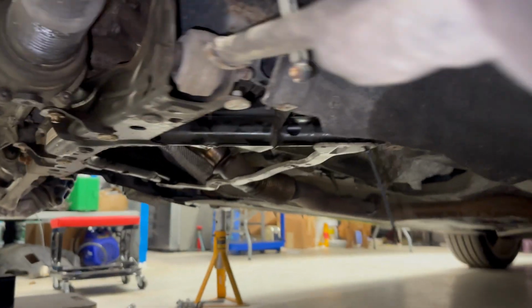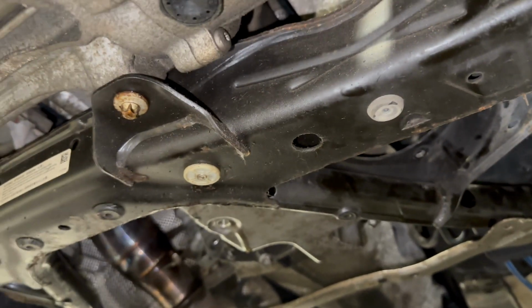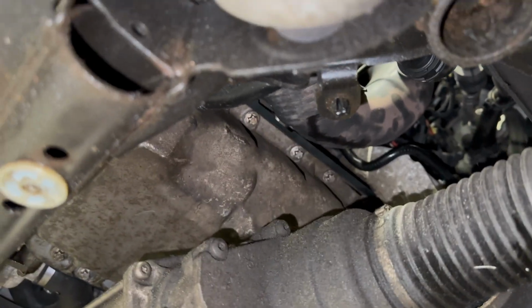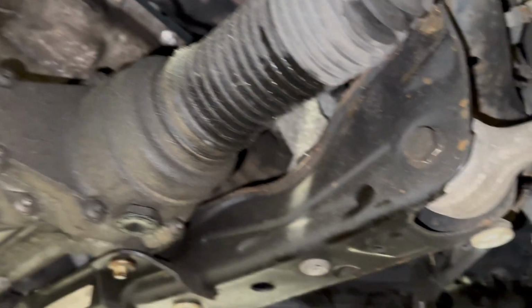I'm having to do this on a freshly rebuilt engine because for some reason the oil pressure is sky high and won't come down. So I'm suspecting the pressure relief valve on the oil pump, which is apparently a brand new genuine BMW part, but we'll see.